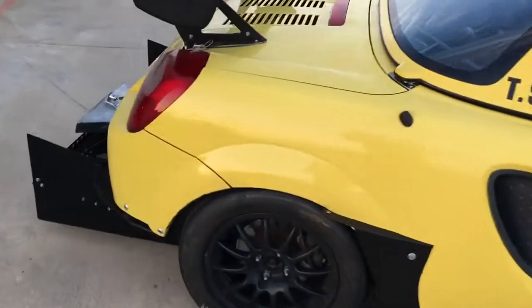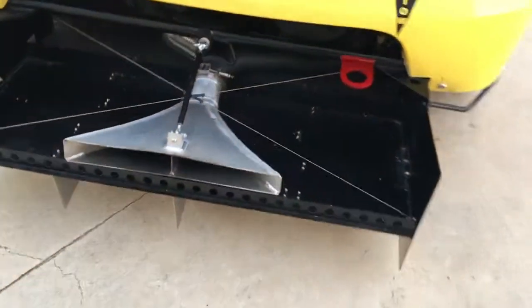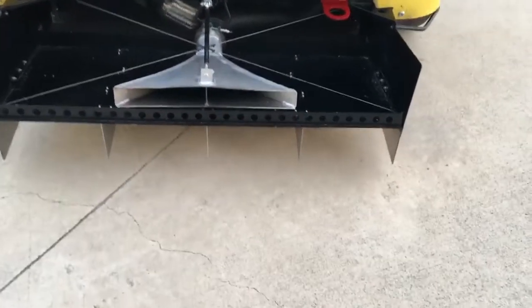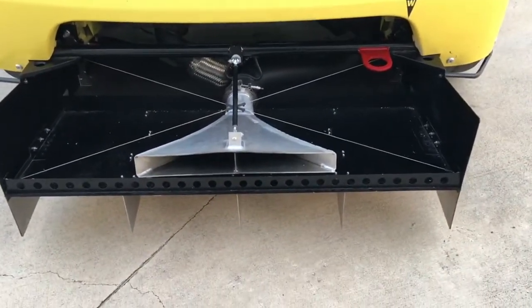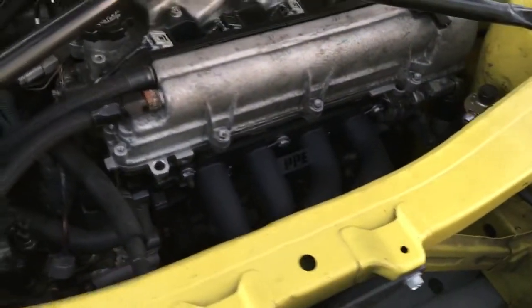Coming around to the back of the car, the first thing you can see is the exhaust tip. It is a blown diffuser — we would prefer it blown at the bottom, but with the crossmember it couldn't be done, so this is the next best thing. It does still help kill that pressure pocket back there. It also has a muffler and a resonator tucked in under there. It is a 3-inch custom exhaust done here. It does have a PP Engineering header, and everything's black ceramic coated.